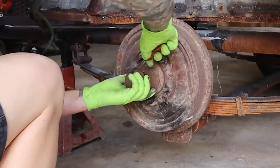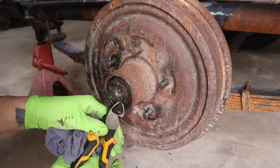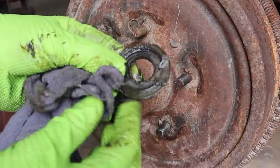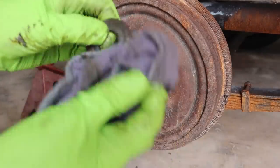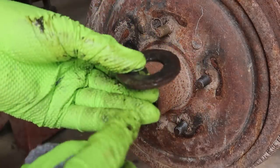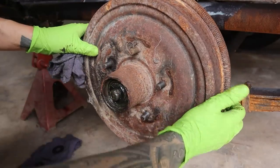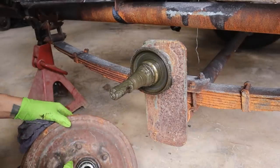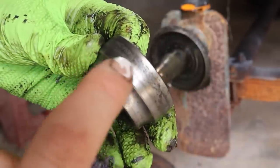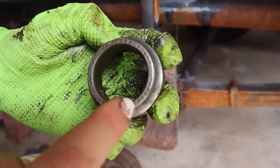Let's get this wheel off and see what I can do to remedy the situation. Off with this little grease cap — that's a little more play than I'm comfortable with. Let's back off this castle nut and check this wheel bearing for wear. I might want to repack this before I head to the swap meet this weekend. Here's the little backing plate washer — there's rust on there, water has gotten in at some point. This washer might not actually be for this bearing — look at the weird cut on the outside edge. Was this modified to fit in there? Now we're going to pull this off. There is pitting — at first I thought it was just staining, but it is not. There's a part number, so I'll hopefully be able to find a new one.